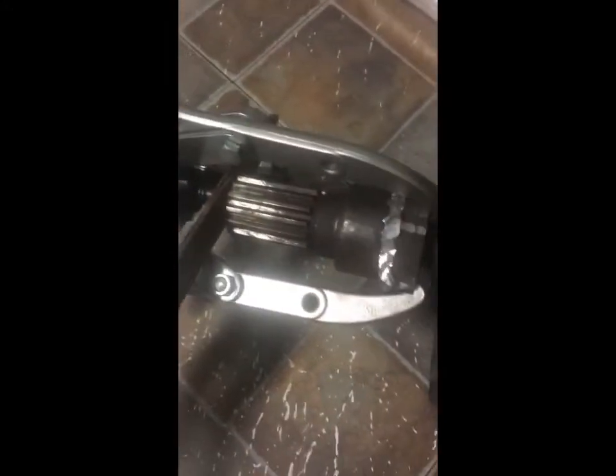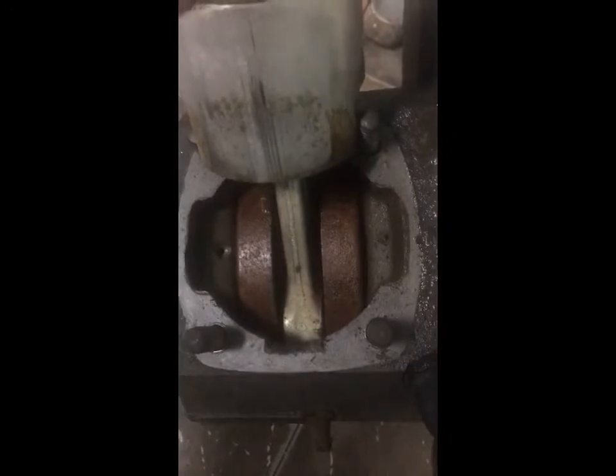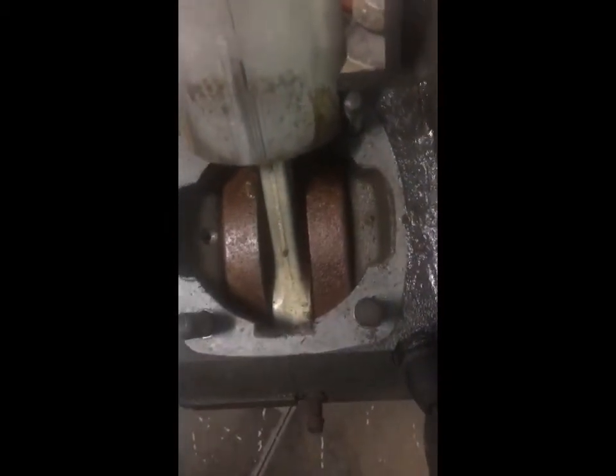Guys, this is the end of the road for this original motor out of my '69 Scorpion. You can see the inside of the clutch part broke off. I've tried everything — heat, pulley puller, beating on it — for days trying to get that off. This part should spin freely, doesn't. Even got a pair of garden shears in there. And if you look on the sides at these weights, there are just huge spots that are gone — rusted away. It is really bad. It's toast.